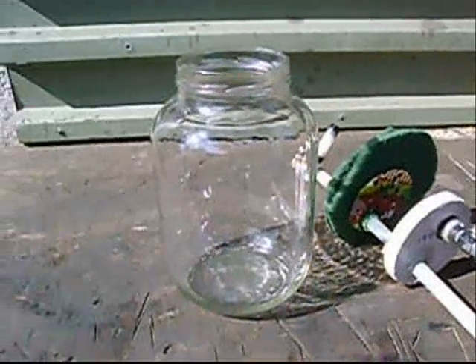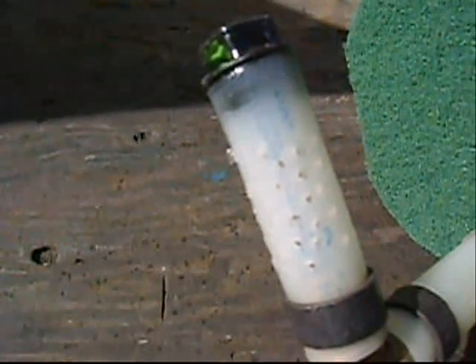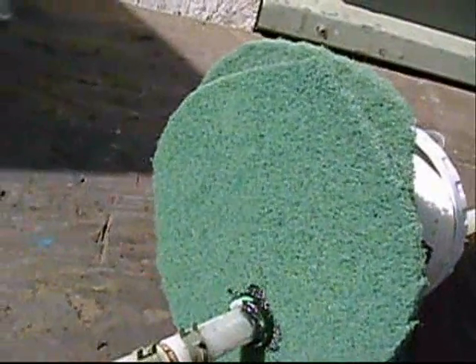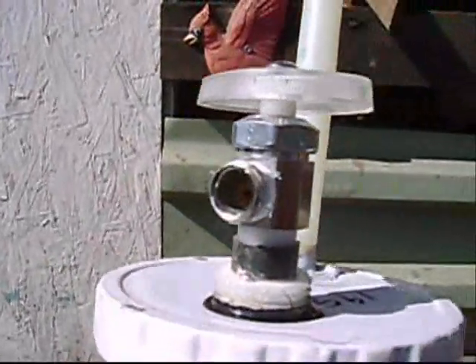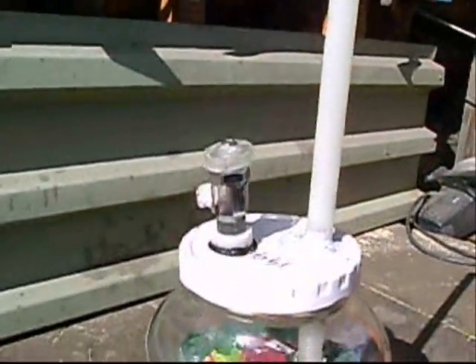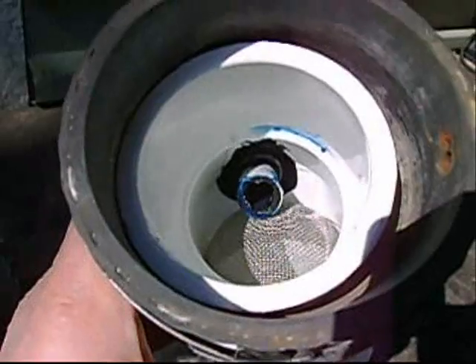Here's the vaporizer that I'm going to use for the water system. I drilled a bunch of tiny holes at the bottom of this vaporizer so we could get some really fine vapor. This kind of a splash guard here I put in there so the water doesn't splash and go up into the engine. This is just an ordinary toilet valve so I can adjust the flow. And here's the complete unit ready to install. This is the spot where the water vapor is going to come in and mix with the fuel vapor — you can also see a screen down there which I made for backfire protection.